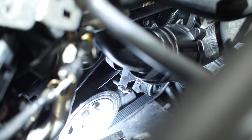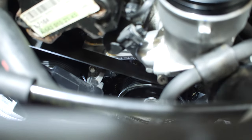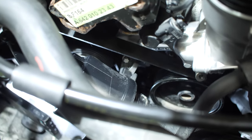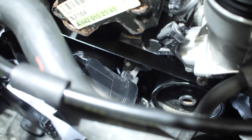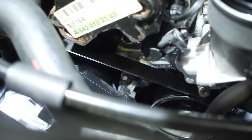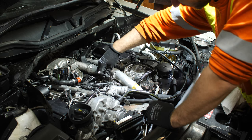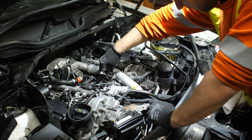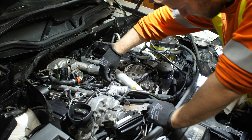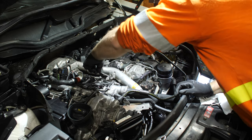For reinstall: push the wrench down, remove your cage bolt to tighten the belt, then install the clip from the black plastic intercooler pipe to the rubber hose. Install the two bolts — longer one on the bottom, short one on top. That top bolt was really tricky; make sure you get it lined up and do not cross-thread it. You can push down and rotate the whole unit to help line up the bolt. Then reinstall the aluminum intercooler pipe — push it into the plastic piece, put the clip in, tighten with the Phillips, and tighten the 10-millimeter stud to the block. Push the intercooler pipe firmly into the turbo — there is a seal in there — then align the bolt and install the Y-pipe.